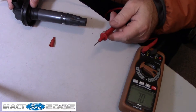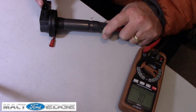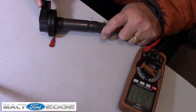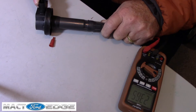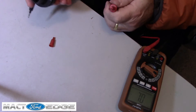As long as your probe is long enough, go ahead and insert the probe in there. Make contact with the spring and then put it on a pin. In this case I'll put it on the second pin and you'll see we have 2375. We'll go ahead and try the other pin — and again virtually the same thing: 2375, 2363. They're all pretty much the same. So 23,000 ohms is what we're looking at for this brand new coil.